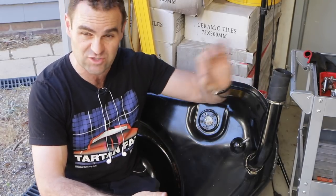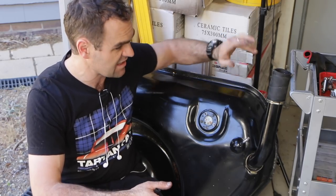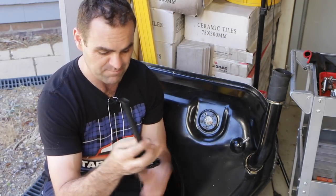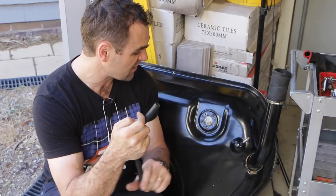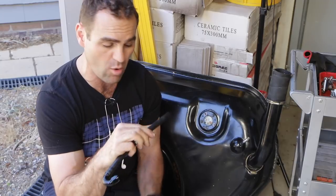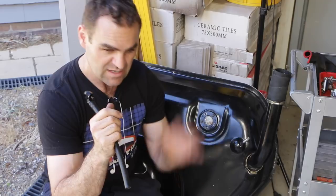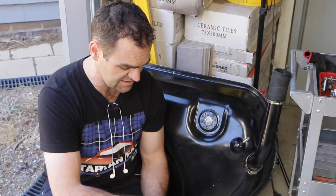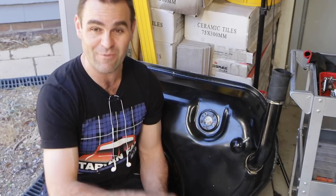We managed to get the dash-5 working quite well with the 8mm return line going onto the tank. But for the feed line, after talking it through, we've worked out we're going to go up to a dash-8 fitting — that should go on there quite well with a hose clamp. It's a bit of trial and error, but let's go back over and start working on the engine.